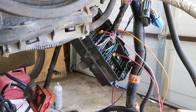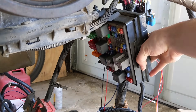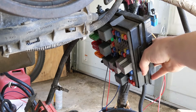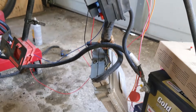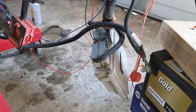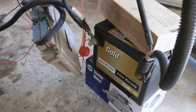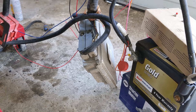I'll show you my general setup here hanging off the side of the engine. You can see I've got the full fuse block from a 2001 Silverado. I've just got the positive cable hooked up to it like you normally would on the vehicle, with positive going down to the terminal on the battery. Got the ECU still hooked into the stock wiring harness, and then I've got ground cables that just go to their normal locations on the engine. The whole thing is wired up pretty much like it would be in a truck.